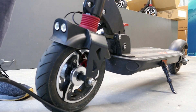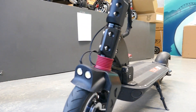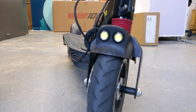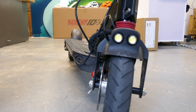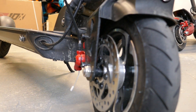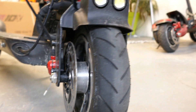Now with the brakes, keeping your brakes at a good clearance and a good feel is optimal and important for the zero nine. If you find that when you brake the disc is bending a little bit, then what you need to do is bring the fixed pad closer to the disc.